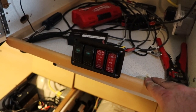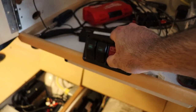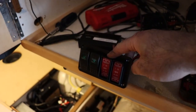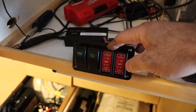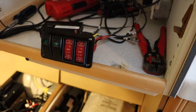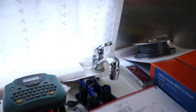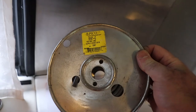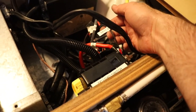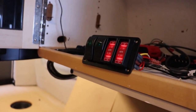It just happened that the air conditioning turned on. The reason you can't turn it off now is because the contactor is opening and closing, but the load center is being run by the converter slash charger, so the lights aren't going to go out anymore. But anyway, they're both on automatic so they'll close eventually on their own — like I said, 30 seconds. I ran numerous two-conductor 14s — I just have a roll of wire here, or two-conductor 16 rather. You need to have two fuses — you need a fuse on either side of the contactor, one to the LED, and then another fuse that provides power to these on the battery side.